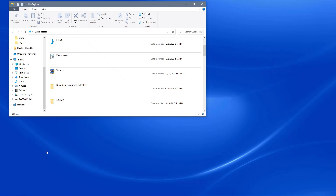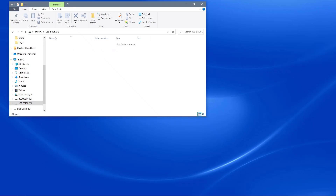The first thing we're going to want to do is plug our USB stick in. We're just in the file explorer — we're going to make sure that it shows up and that it is empty. If it has anything on it, it will be erased and it will be unrecoverable. So make sure that you take all the files off of it, or better yet, just use a brand new blank USB stick. This one here is 32 gigabytes — that should be more than enough for Ubuntu.